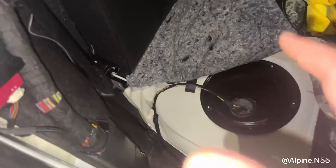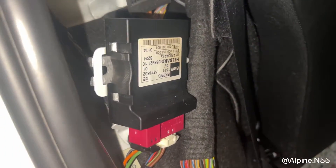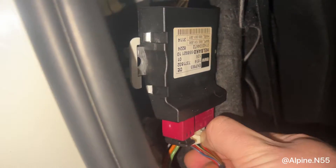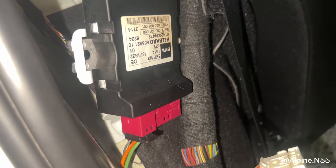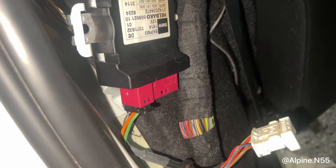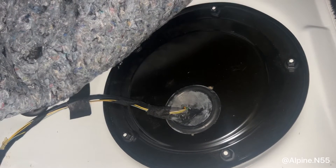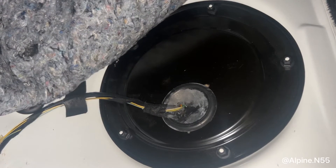The next steps are going to be to take off the actual rear seat, and then take off this side panel here to expose the EKP module. Go ahead and take off the harness for the EKP by pushing down and then pulling it out. After that, start the car — this is going to empty the fuel line of any current fuel so that you don't have any issues taking the line off the low pressure fuel pump. With the system depressurized, go ahead and take off these five nuts from the top hat, and then you'll be able to get to your low pressure fuel pump where we're going to be doing the install.